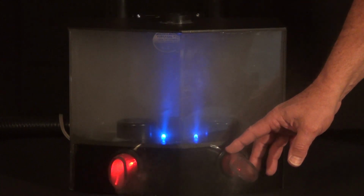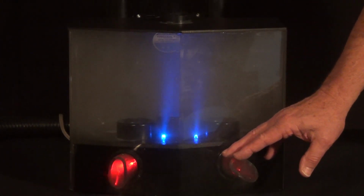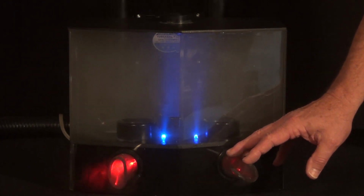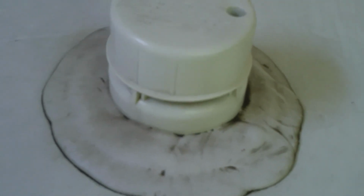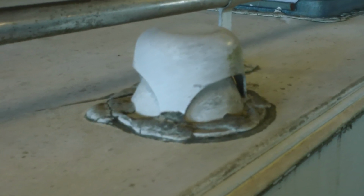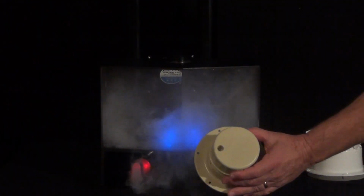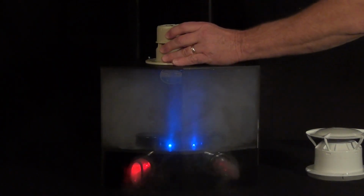The red tubes you see here indicate what we call unintentional openings from the waste plumbing systems into the interior of the RV, such as those faulty seals or empty P-traps I mentioned earlier. The typical and commonplace sewer vent cap simply does nothing to aid in the removal of fumes and odors. In fact, in some cases, these types of vents can actually exacerbate the problem. This vent does nothing but keep leaves, debris, and critters from entering the vent pipe.